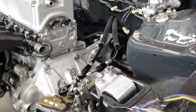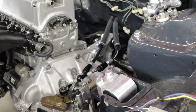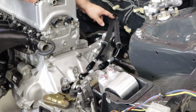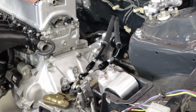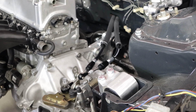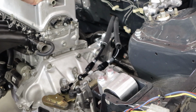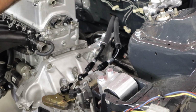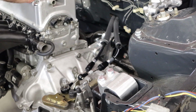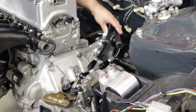So Cody's going to get his shifter cable bracket, but this is our new heat sleeving that we're putting on these shifter cables now. What I think we'll do is, we've got some metal bands, so we'll band them together, and that'll cover up some of this hole. We'll also make a plate that goes there to cover this up. But this stuff is super nice. It's going to keep the majority of the heat off the core of the cable, and it replaces the white fiberglass heat sleeving that we've been using for a long time. So if you've got a new set of Hybrid Racing shifter cables, it's going to come with this black woven heat wrap. It's really nice. We'll get this connected, get it banded, locked in place, and then we'll put the shifter in.